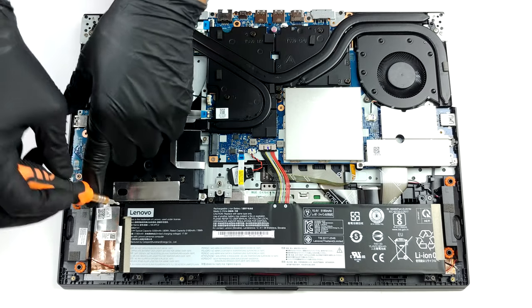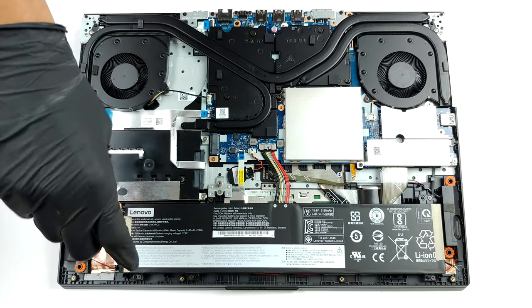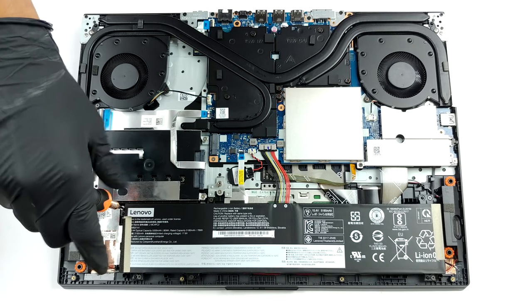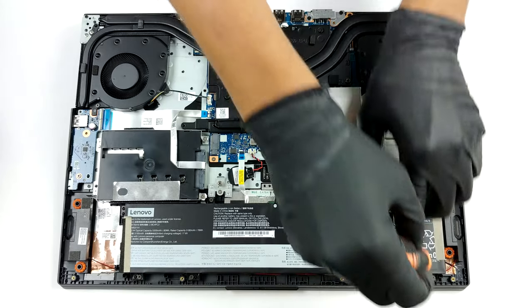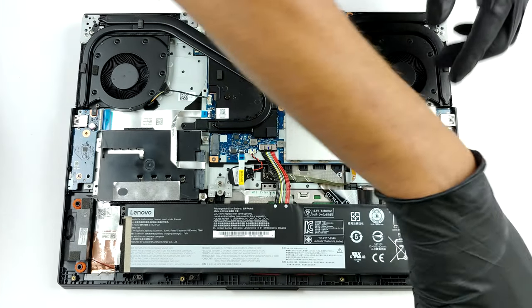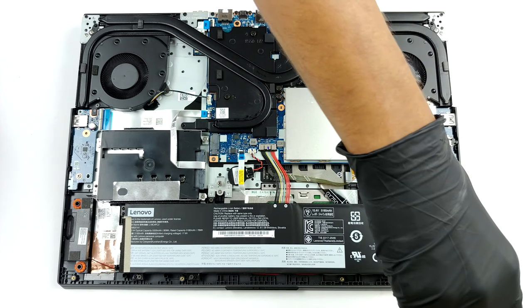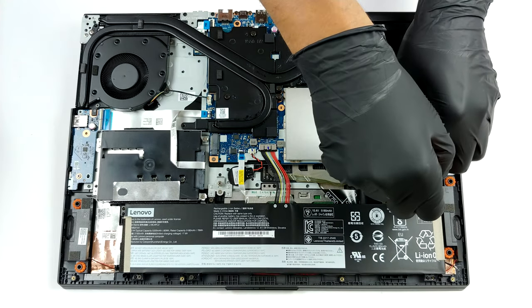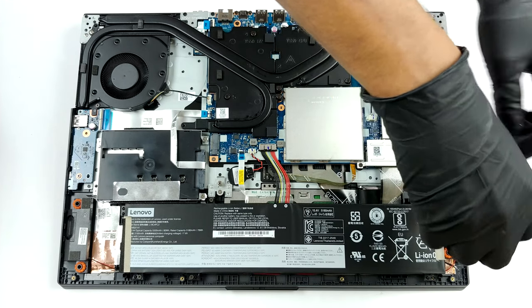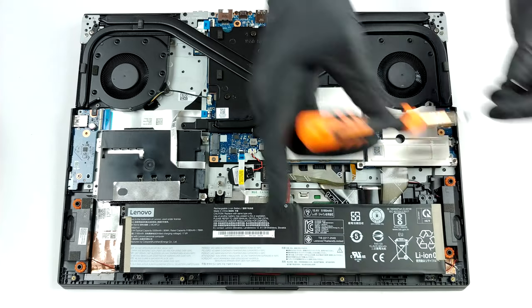When it comes to cooling, there are only three heat pipes. One thick one, which is common for the CPU and the GPU, another rather thick one cooling the CPU, and one thin and long heat pipe for the graphics card. In order to aid the thermal control of the video memory and the VRMs, there are two metal plates. Interestingly, they have a Y550 branding, which is indicative of hesitations in the naming process of Lenovo's new gaming machines.